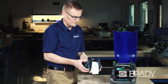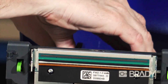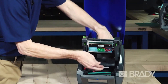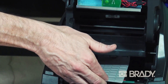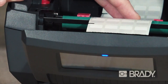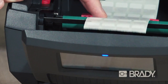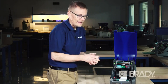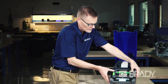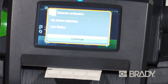In this case we've loaded a different type of label onto the roll holder. Follow the same instructions for dropping the roll holder into the printer and feeding that label material through the alignment guides — everything is the same. Spread the guides and close them back up to the right amount, tuck your label material through the slot, and again to have the printer select that sensor and tell you where to set it, simply close the print module and raise your control panel.